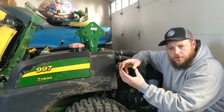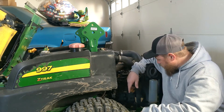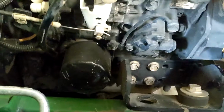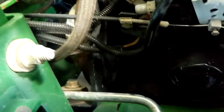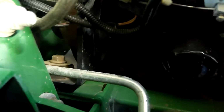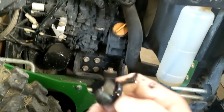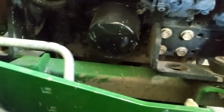It's just a tiny little bit of oil and she takes a lot of abuse. So we'll probably start by changing the oil and the fuel filters, the air filter. This Yanmar holds 1 gallon of 15W40 of whatever brand you prefer. I prefer John Deere or Rotella. It's a 19 millimeter head. It's kind of a bear to get a drain pan normally under here. I have to pick that up and slide her under.